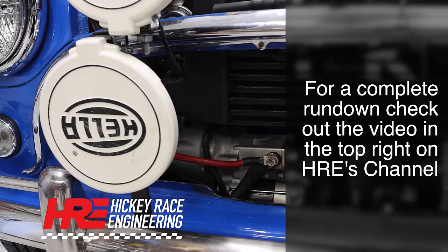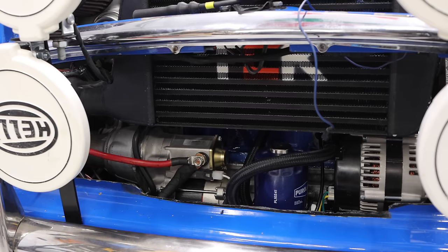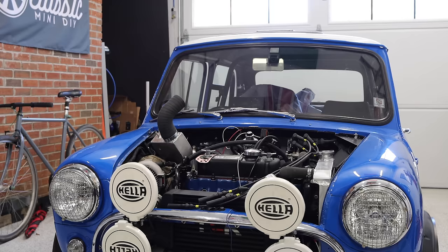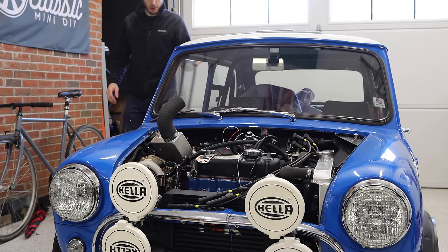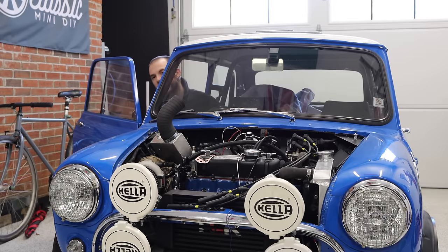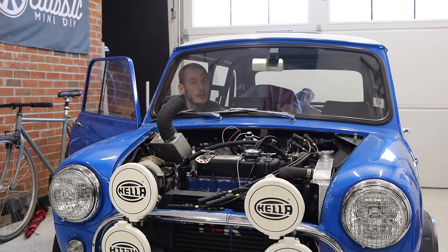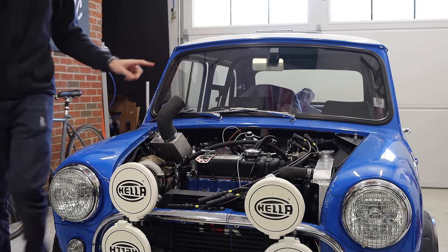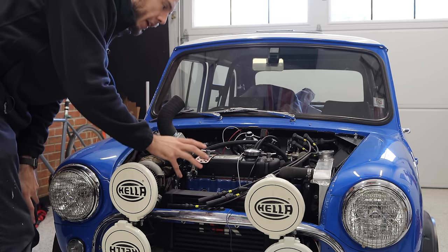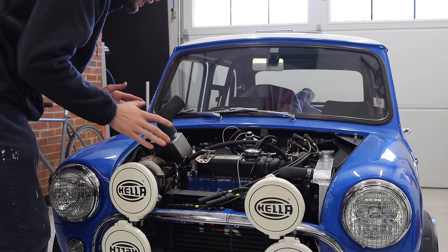The issue arises from a mixture of the type of flywheel I have, the type of drop housing I have, and the amalgamation of those parts in relation to my engine — I have a bit of a hodgepodge engine as a result of upgrading things throughout the years. The starter has been installed. I didn't show the install because it is really just bolting up a starter, but you can see it fits under that intercooler really nicely. Battery is connected, it's been charging overnight, we're not in gear, ignition is not on. We got oil pressure — we're looking at about 70 PSI. I'm very happy with that.